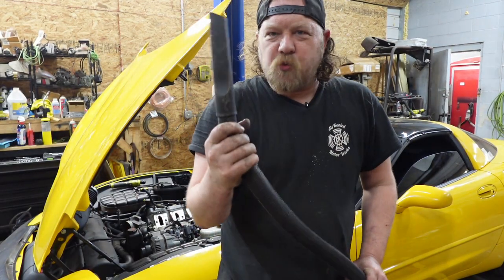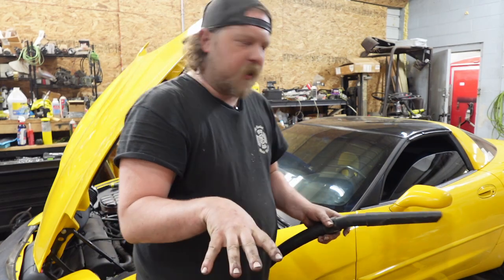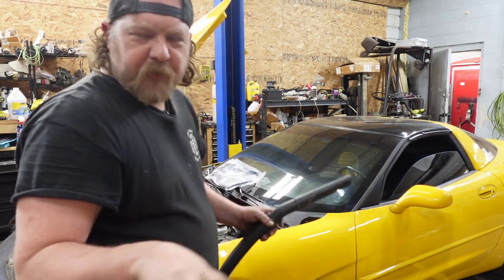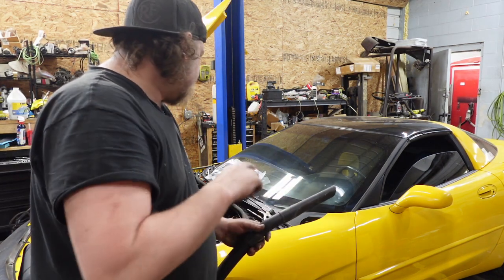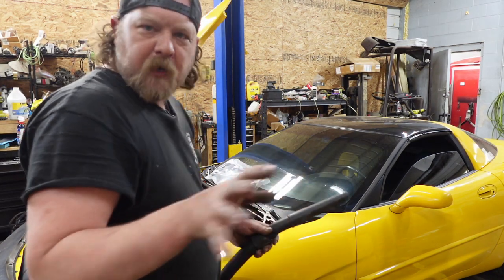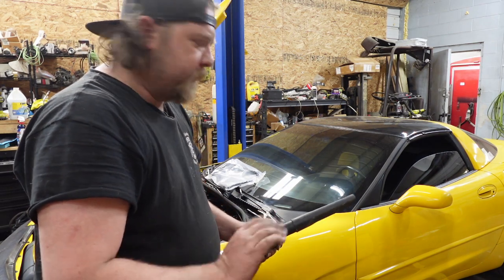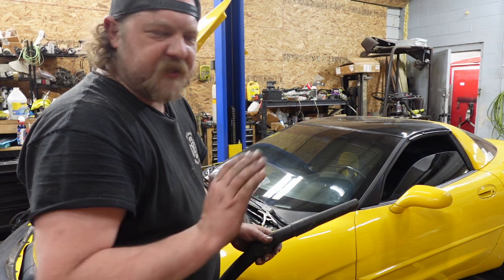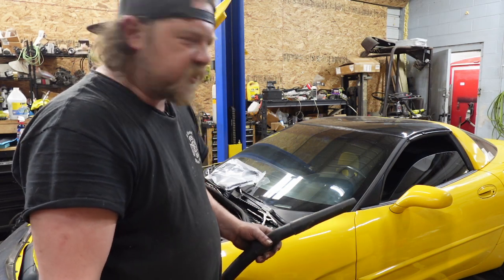All right, guys, I'm gonna do some quick vacuuming action to get this thing cleaned up, and I'll bring you in and show you what I got going on. But definitely this oil pressure sender has been changed before. Cam sensor looks original. So I'm thinking someone was diagnosing top end versus bottom, exactly what I was doing. And I'm leaning more towards it's my backing plate that's leaking, not so much the rear main. Regardless, it is going to that proctologist most likely.